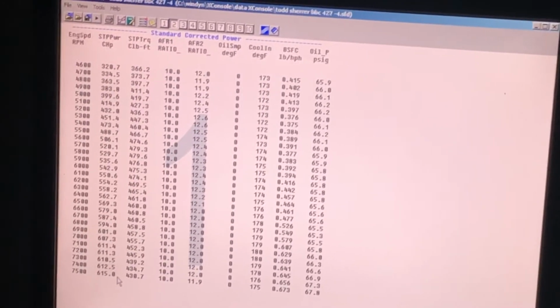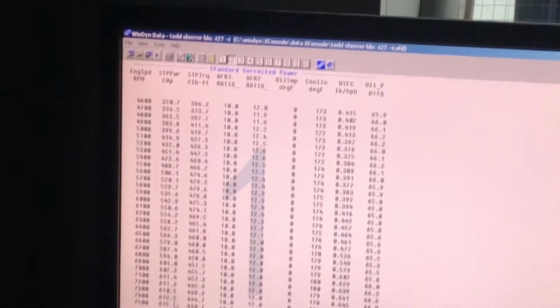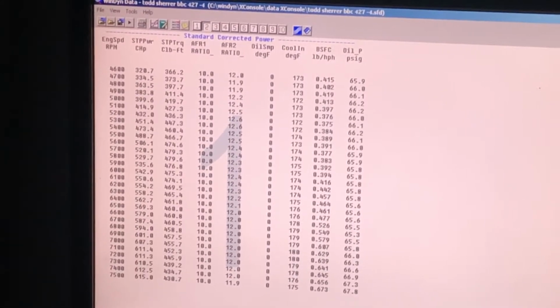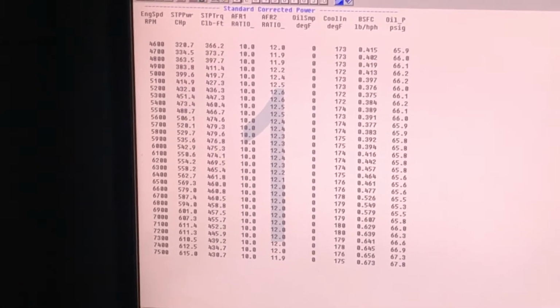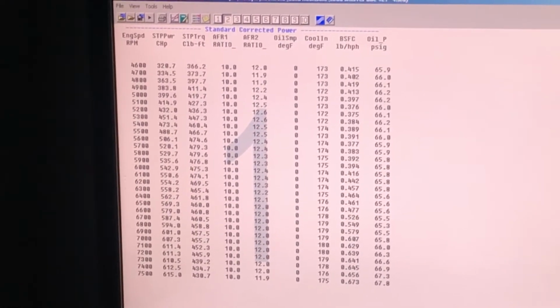I noticed the oil is hotter now. It's not as long of a pull, and the oil is hotter. Because you're doing a pretty long dyno pull, like 6 seconds, and we did two in a row. If we shortened the dyno pull a little bit, it wouldn't be any issue. The oil is thin. So, timing? I think timing. Do you want to maybe shorten the dyno pull a little bit, just so it's a little quicker? Yeah, we made it faster.